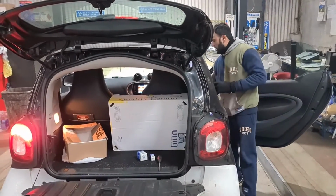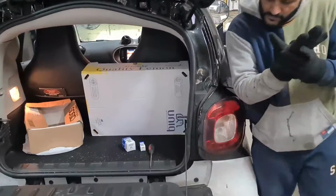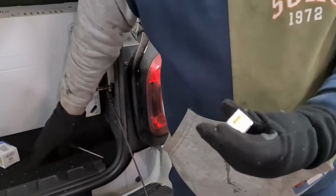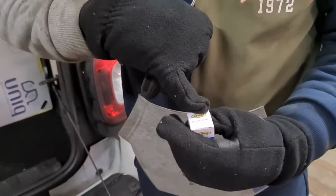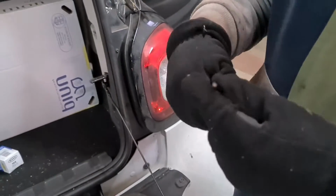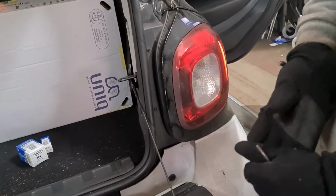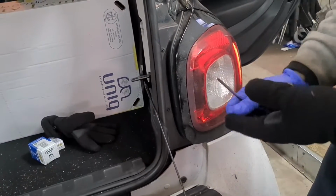First of all, switch the ignition off. The bulb and the tools you need: a 380 bulb right there, which you can find in the description. The tool you need is a Torx bit T20. If you haven't got one, you can even use a flat screwdriver as well if you wanted to.